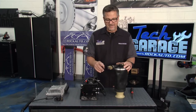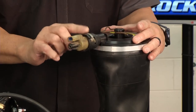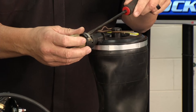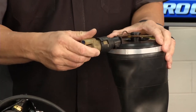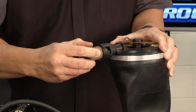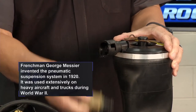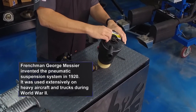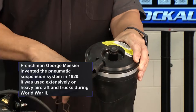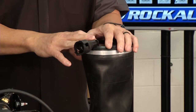What they're going to run into over there is a clip on top — you're not going to be able to see it because it's buried up in there, but they're going to have to pop that off. Get a screwdriver up in the frame and pop that off. This is an actual air solenoid right here — one, back, two, and out. Two locks out and then it's sitting right there. Then they come to the top right there — you can see that clip. Reach up in there, get your pair of pliers, pull that off, and the top of the bag will be ready to come out.